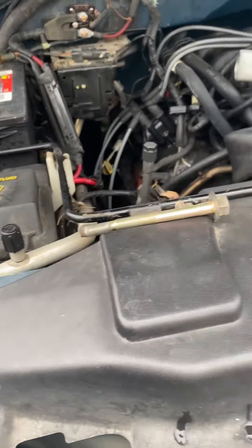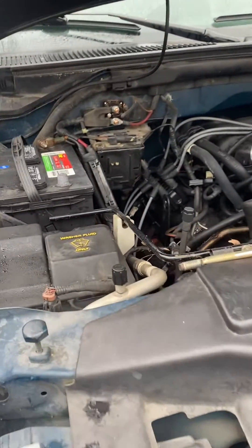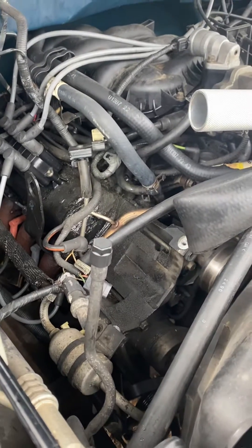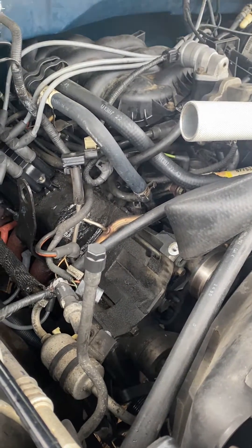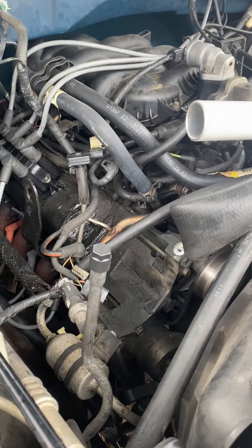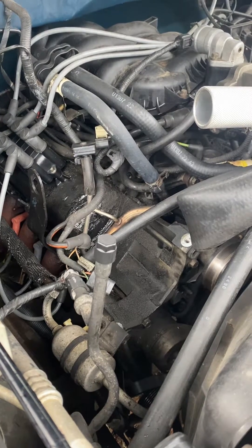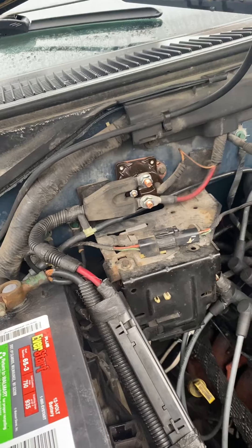Hello, it's Voodoo Denny here. I've got a Ford F-150 with a bad alternator. Before it was a bad alternator — I'm replacing it right now — it would crank up, run a little while, and wherever I went, if I'd stopped and turned the motor off, it wouldn't start again. So I've done a few things to it, like replace the solenoid.